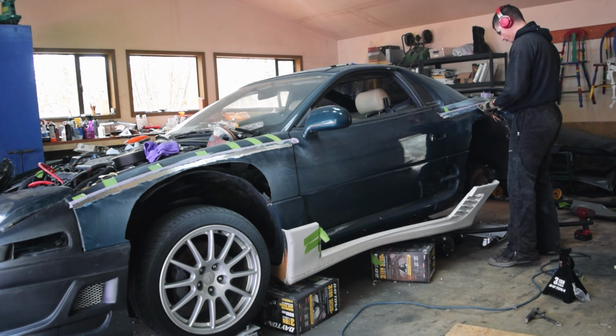All right, so at this point, we got everything ground up to where we need to be. All the metal is exposed on the front and the back. We got our fenders completely trimmed out. I threw some sealer on the side to help hold the side skirts in place for now, and the wheels are helping it set in place. Then we're gonna go down and do permanent mounts. In regards to the trimming, that is completely done, and we're at the stage where we need to weld.